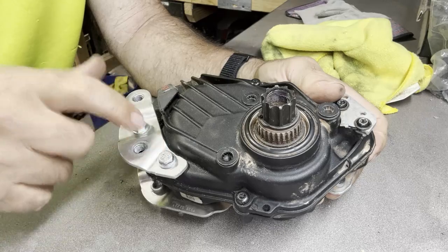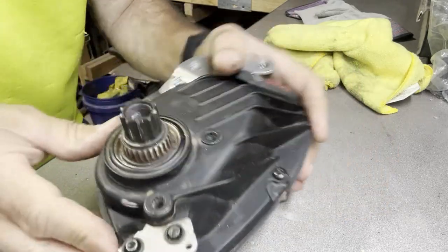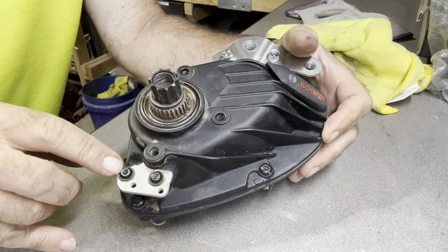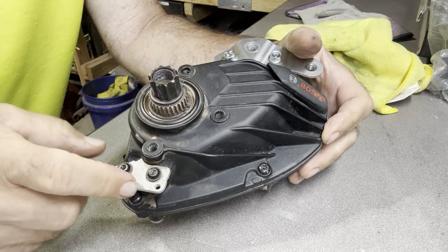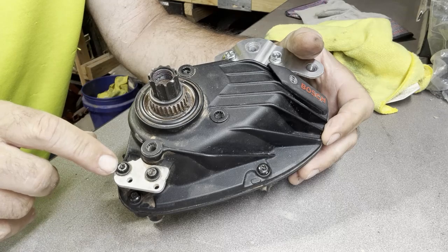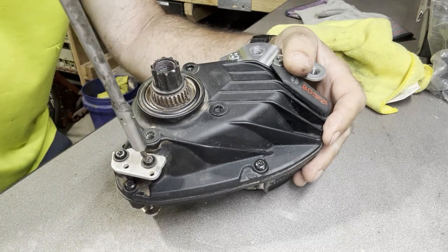I re-tapped them with M6s — they're M5s that come with the bike. On these you need a five-point lobe with the safety bit, a little harder to find. It's not a regular security Torx, so you've got to find a five-lobe one.